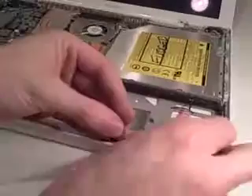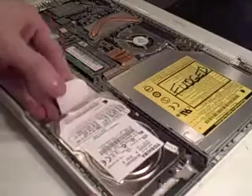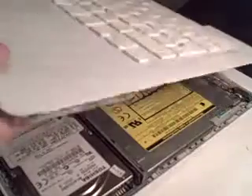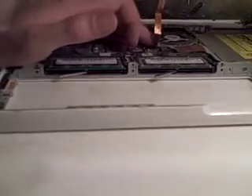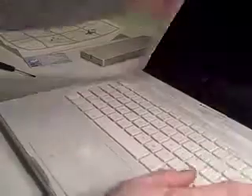Check all four plastic bits are present. Then put the screws back in behind the hard drive, put the hard drive back in, put the keyboard back on, plug it into the board carefully — click — brilliant. Lower the keyboard down and push it in around the edges making sure it's flush, then close the computer, flip it over, and put the bottom screws in. Remember the small one goes in the middle.